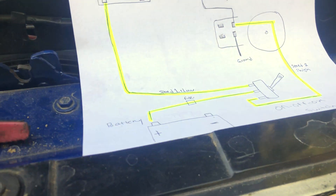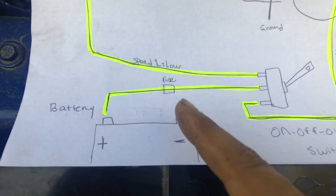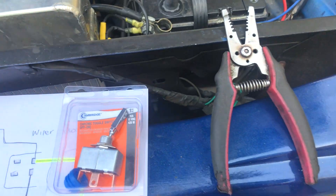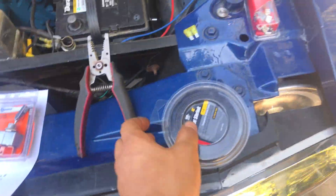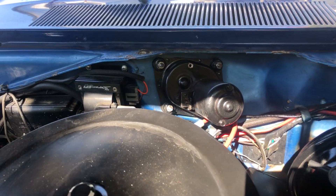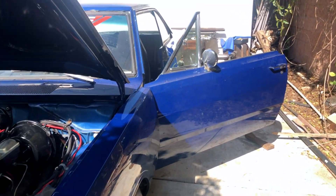This bottom pin on the wiper motor is just grounded to wherever you'd like. To get the power for all of this, we're running a wire from the off position of the toggle switch, with a fuse in the middle, all the way to the battery. The basic things you're gonna need are: an on/off/on toggle switch from AutoZone, some wire cutters, wire, heat shrink to secure the ends, a 20-amp fuse, and quick disconnects to plug into the pins on the wiper motor, ballast resistor, and toggle switch.